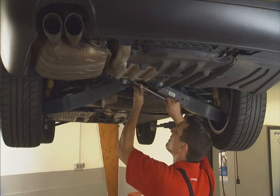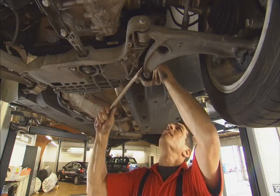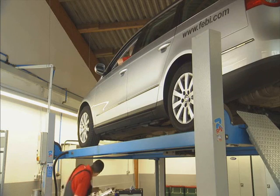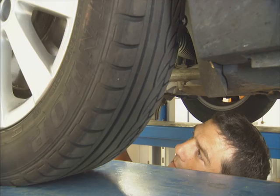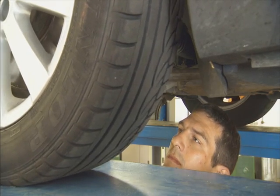Testing with a lever allows only limited movement. Often, this can even cause damage to the underside of the chassis, for example. Even though checking the vehicle on a four-poster ramp goes some way to reproducing driving conditions more accurately, it is still not possible to simulate real driving situations. Often, a second mechanic is required to find damage that is difficult to locate.